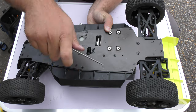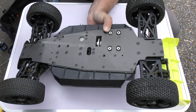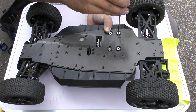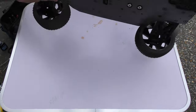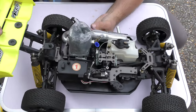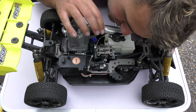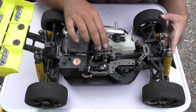Flip it over — still holding the engine. Need the bigger screwdriver and again we're going to tighten the bottom screws diagonally — always tighten your screws diagonally. I'm not going to go all the way, just making sure that with them relatively tight we've still got a good gear mesh. Roll it, listen to it — and that looks perfect.